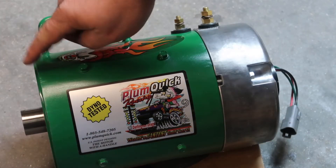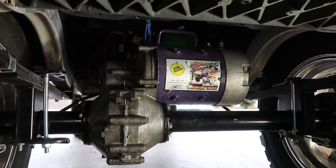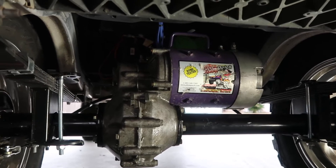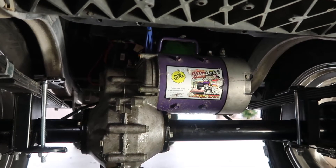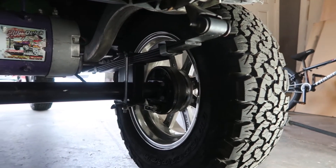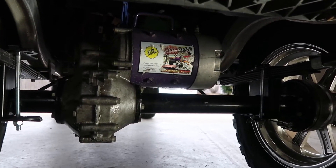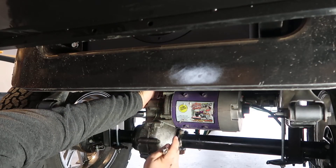In case you're wondering why I'm replacing one Plum Quick motor with another: the Plum Quick Bandit is their entry-level motor, and it's great to use with all stock hardware and equipment. I have it on my single-cab four-seater golf cart. The reason we're replacing it on this limo golf cart is that it's lifted, carries about six people, has BFG all-terrain 27-inch tall tires on 15-inch wheels — I need maximum torque, not speed. There's nothing wrong with the Bandit motor; it just doesn't fit this application. This Club Car takes 7/16 inch mounting bolts — three of them.